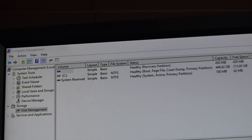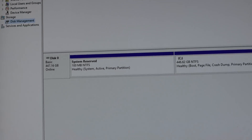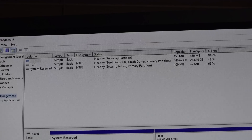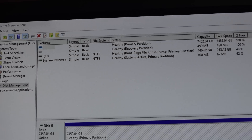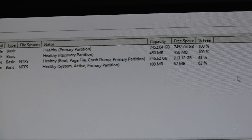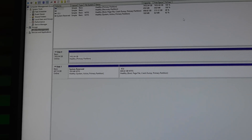Okay, so I'm booted up and it is not recognizing the 10-terabyte drive — so that's interesting. This is obviously probably one of those that you need to disable the third pin in order to get it to boot. Instead I'm going to check my results by plugging in the 8-terabyte drive and the other drive, which is just a regular Western Digital Red — nothing shucked, just a standard drive. That one immediately popped up as recognizable. So obviously these 10-terabyte shuck drives need to be modified to be usable in a regular system.